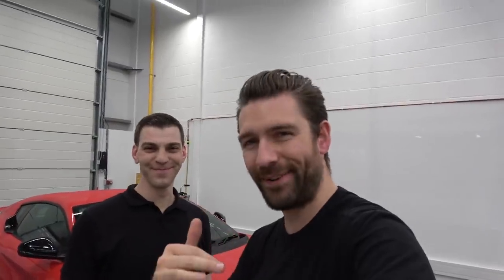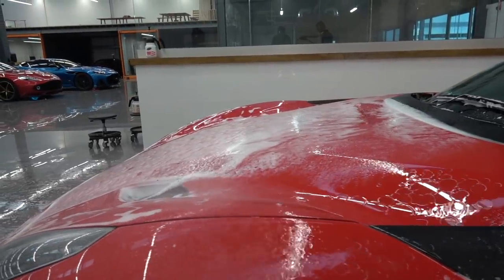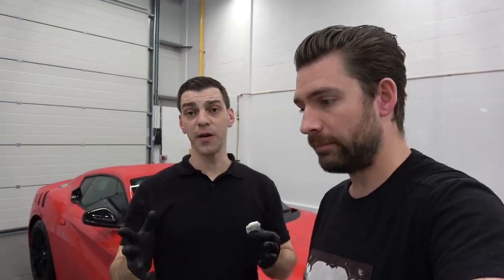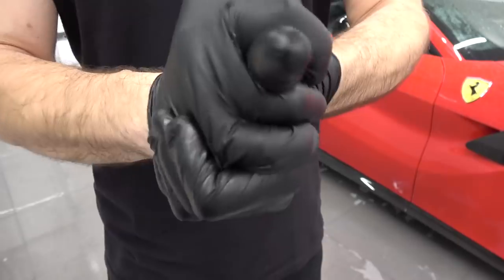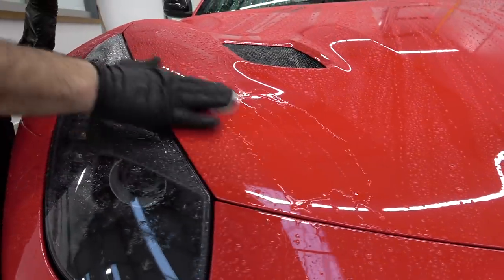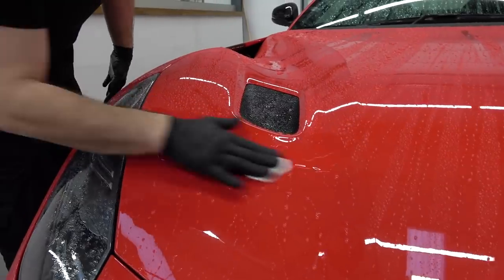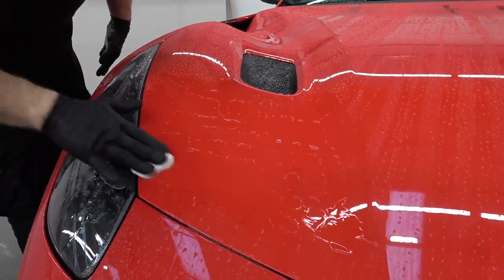Now we're at the clay bar stage, and there's a particularly useful application because of the pure water. There are two types of clay bars — one you can use with water, the other you have to have a lube or quick detailer to make the clay bar glide. Luckily we use a water-based one, so as soon as we rinse down with pure water we can use the clay bar straight on it. The benefit of having pure water is we can take our time clay barring without worrying about dry spots. Similar to the wash mitt, use straight lines — if you do get any contaminants picked up in the bar and it leaves micro etches in your clear coat, it's just easier to buff out. This is also crucial for PPF prep — any contaminants risk the PPF not adhering well or peeling later in life.